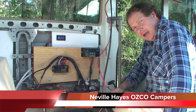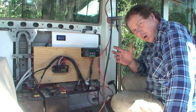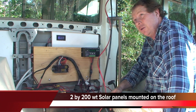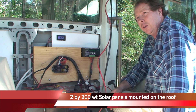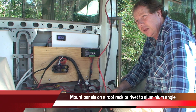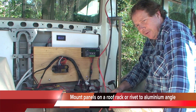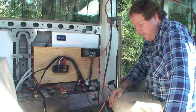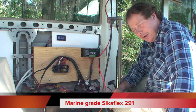Good day, just a little brief overview on the solar and a bit on wiring. I've got the two solar panels mounted on the roof with brackets, sealed and all that — pretty straightforward. You can mount them on a roof rack or a roller roof rack mount. I made my brackets out of aluminium angle, riveted them onto the roof, and sealed them with good marine Sikaflex.